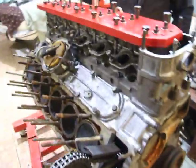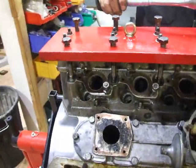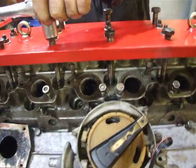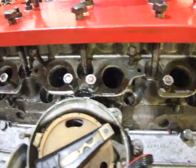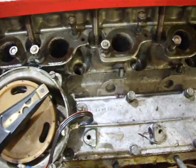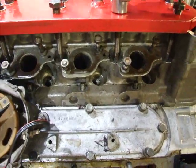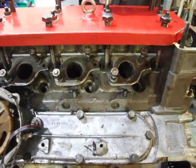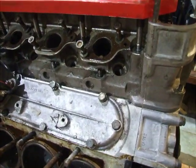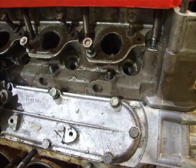So what we're going to do now is have a quick look and break the seal on this head and start to jack it up. See, all he's using at the moment is just a straight half-inch ratchet and a socket, and he's winding those studs down straight onto the head bolt.